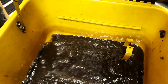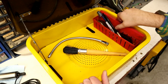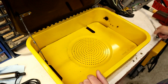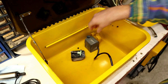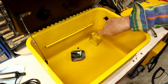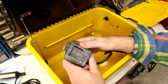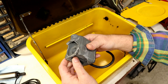How's this for yummy sludge? Okay, with all the sludge cleaned out of this thing, I'm going to show you where the pump lives and how to get to it, and what the problem with the pump is. The pump is just held in with this little bracket that's welded — or spot welded — into the bottom. And as you can see on this pump, like I said the first one lasted pretty much 25 years, this one three months — it completely dissolved.